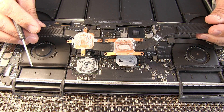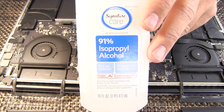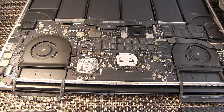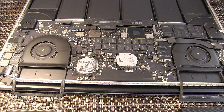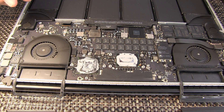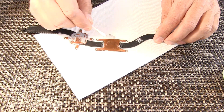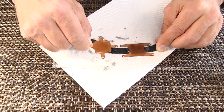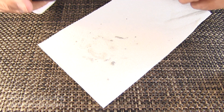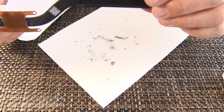I will clean it off and then redo it. In order to remove the thermal paste from your GPU and CPU, you will need some isopropyl alcohol and a whole bunch of Q-tips. Begin slowly and gently cleaning everything off. Make sure you do not get the isopropyl on a surface because it will destroy your table. Remove the thermal paste from the heat sink first to build confidence. Make sure that the vents are all clear of any dust and debris while you have this off.